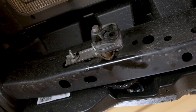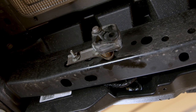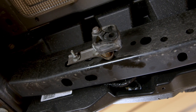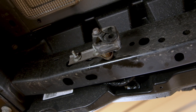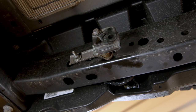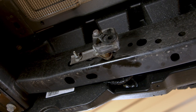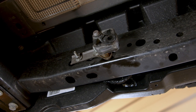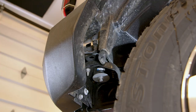The next step is the rear hanger located on the rear metal bumper. If you have a 2.3 like we do, you have to unbolt this and flip it upside down. If you have a 2.7 liter, you want to use the provided 2.3 hanger and again orientate it upside down. Unfortunately, the nuts are welded to the bracket, so you have to get the bolts from the other side. The only way to do that is to pop off the rear bumper — it's actually not as bad as it sounds.